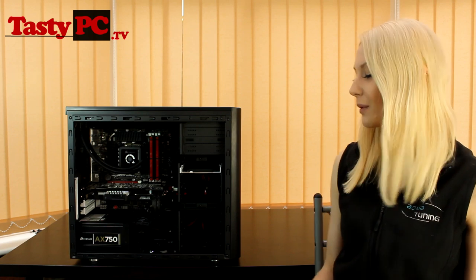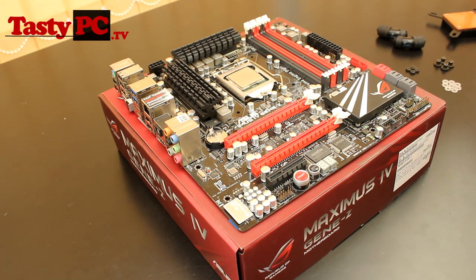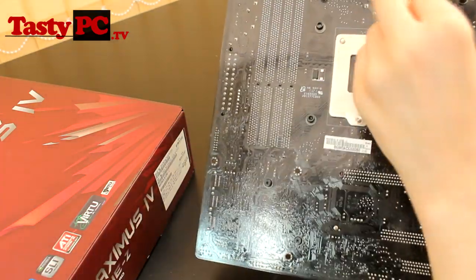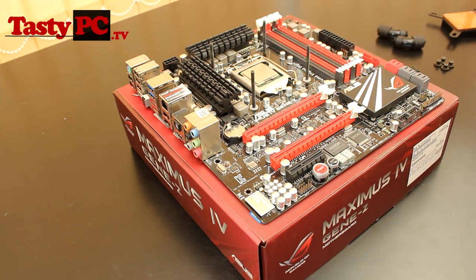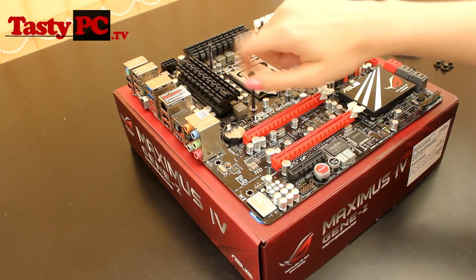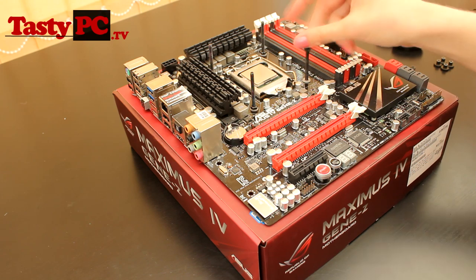The first thing for me to do is completely strip it down as much as I can. As you can see, I have already removed all of the hard drives. The first thing I'm going to do is fit the Phobia water block. I did actually have to remove the motherboard to be able to do this, because the Arc Mini CPU cutout is slightly off from where I need it to be to fit the mounting screws while the board is still inside the case. But the majority of you won't have to do this. I have just fit the mounting screws and now I am just tightening everything up. I am only going to hand tighten because I do find that that's enough, but it does come with an Allen key in case you want to use it.